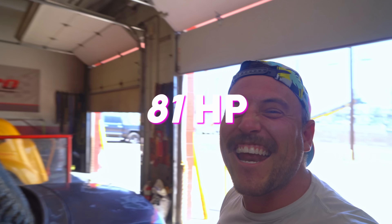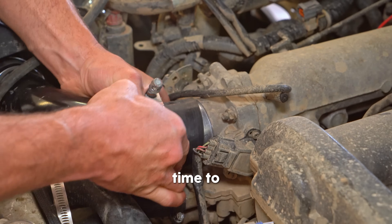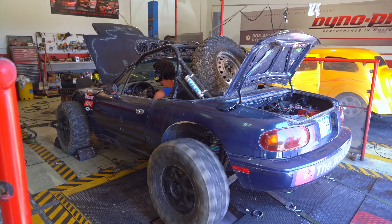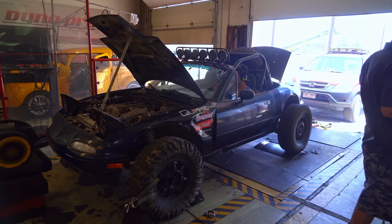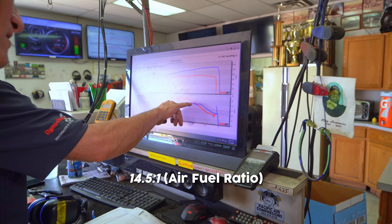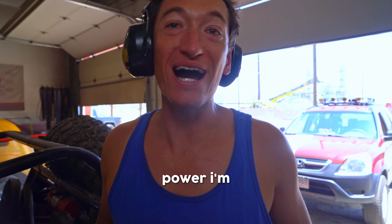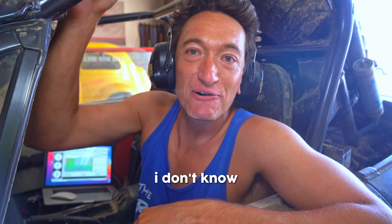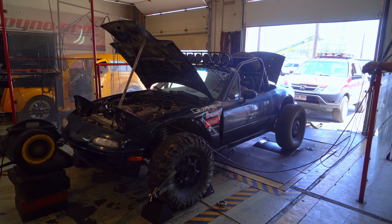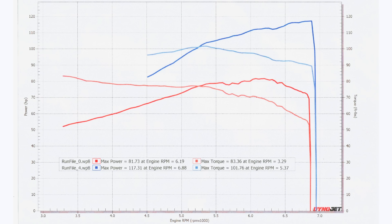That was crazy. 81 horsepower. Brutal. That's unbelievable. Now the question is, can we break 100 with the supercharger? Let's see what we're at — 115. So that's 35 right there. That's not bad. Let's see if we can play with it. 14.5 to 1 air-fuel ratio — we need to be down around 12 for max power range. We tweaked some numbers and added a bunch of fuel. 117 was our final number starting from 81 — so 37 horsepower. That's not bad. That's more than we both thought — it's way more than I thought. I'm excited to actually try it out on the track. Thank you guys for watching — stay rad.